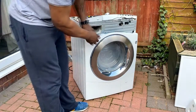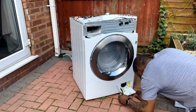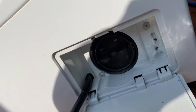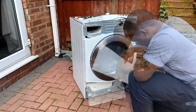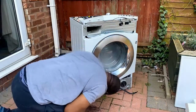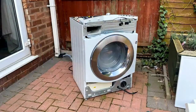It's two screws at the top of the door housing — remove those too. Then get down to the drainage plug area — there are two white screws in here. Move the cable out of the way and undo these two screws. Once you've got them out, just pull the bottom cover forwards, unclip it, and lift it out. Then remove the two screws at the bottom of the door housing.